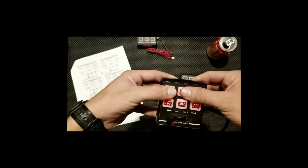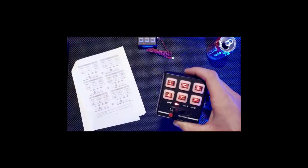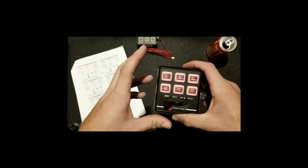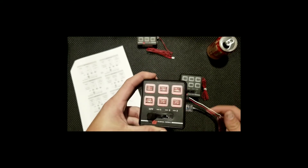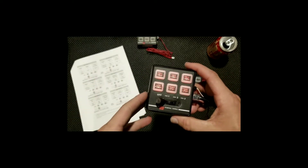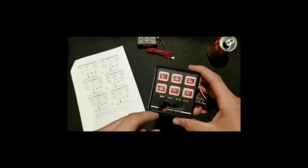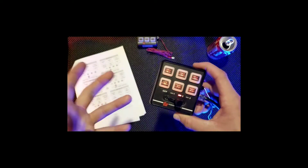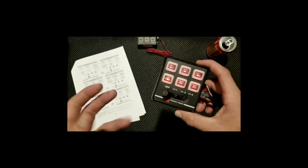I'm putting it back on keypad five for programming purposes because I want to show how to change patterns for different modes. Wiring is super easy — just hook up power and plug your CAT5 serial communication cable from the light bar into the controller. Then it gets into programming: hold the top three buttons to get into keypad programming mode, depending on what function you want push the respective button, or use the slide switch for point-one or point-two variants.